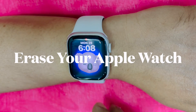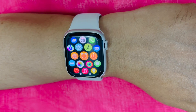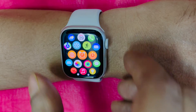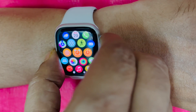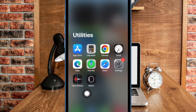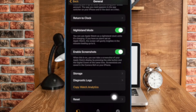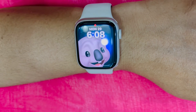If you still can't capture a screenshot on your Apple Watch, I would recommend you to erase your Apple Watch and re-pair it with your iPhone. This nuclear solution has an invariable record of fixing even the most complex watchOS issues, therefore it deserves to be given a chance as well. To do so, open the Watch app on your paired iPhone, now select General, then choose Reset, and finally tap on Erase Apple Watch Content and Settings and confirm the action.